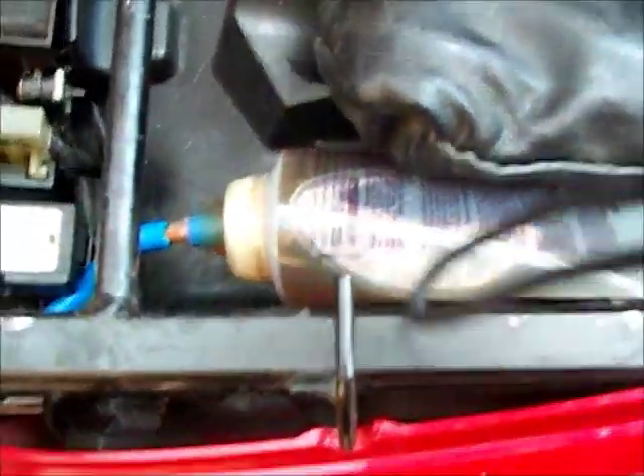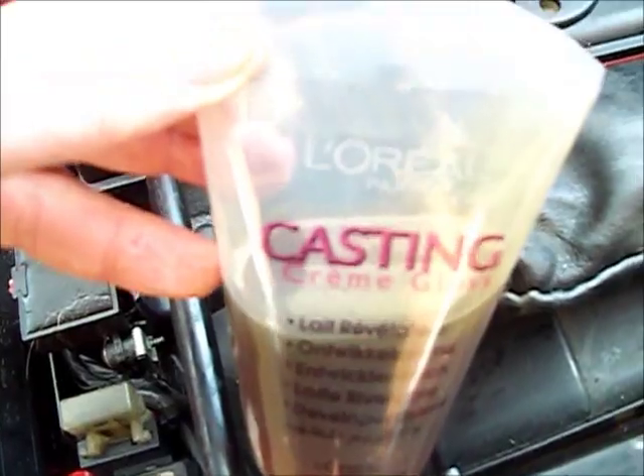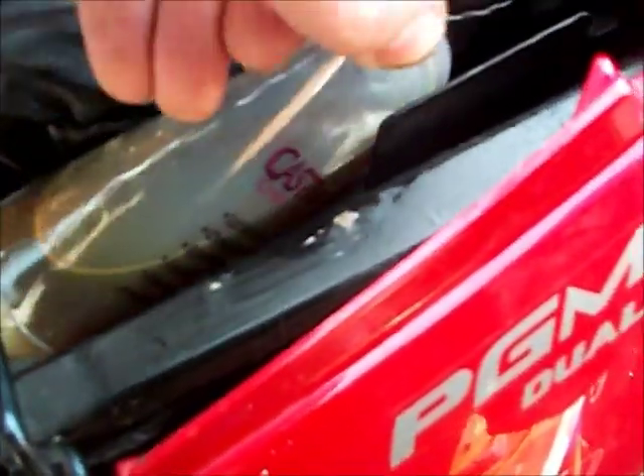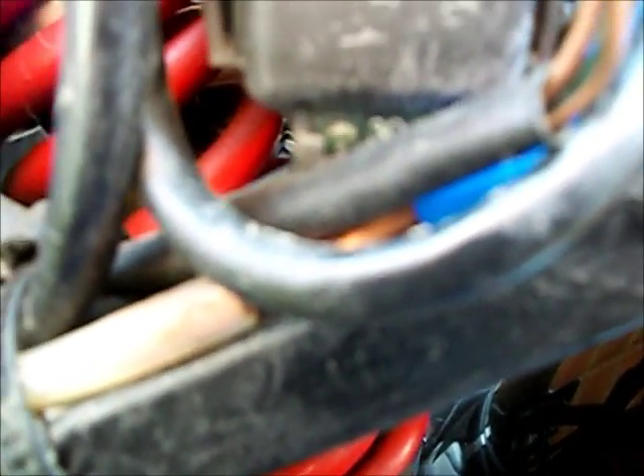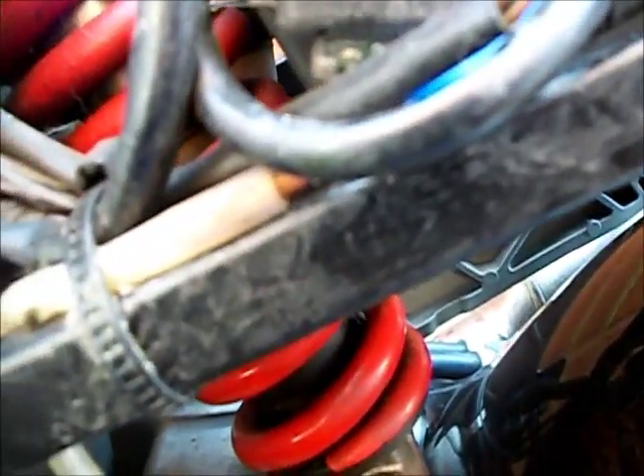I've crimped another piece of copper pipe really quite tight so it restricts the flow, and then the pipe comes back up and joins with another bit of copper pipe with a bit of plastic pipe on one side. The bottle is one of those hair casting cream or gloss bottles because they're flexible. I might add a tap here so you could always turn it off, and when I'm not using the bike I'll just take the bottle off so there's no oil coming through.